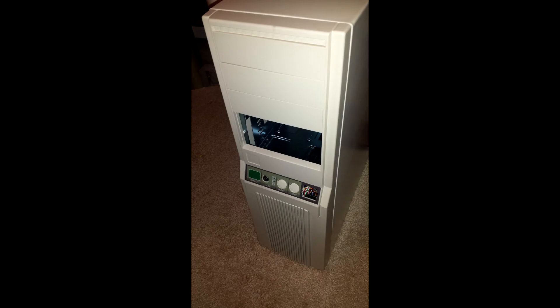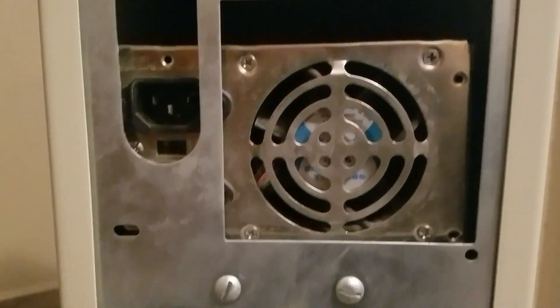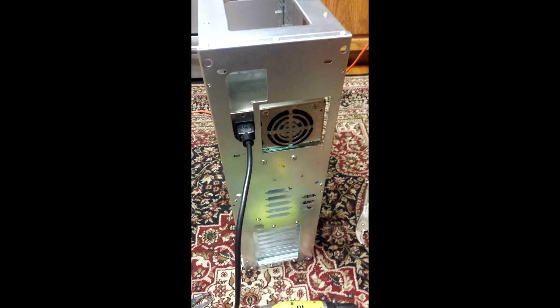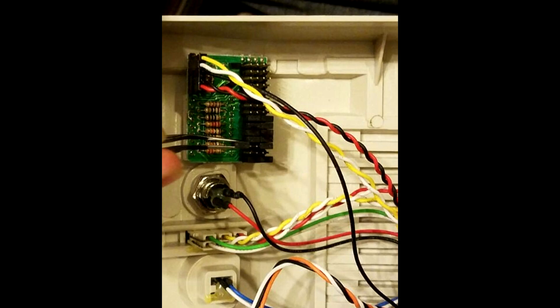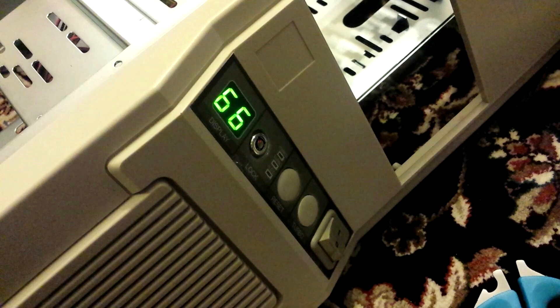Before putting parts together I needed to prepare and modify the case, which was by far the hardest part. This 486 used a different form factor of power supply than the standard AT size. I ended up removing a small bracket from the case and bolting it to the top of the power supply cover, mounting the PSU upside down so the power connector lined up with the opening. The back looks janky but it's worked for three years. Connecting the power supply to the switch was scary since I had no guide, but friends online helped me out. The MHz display programming was also a pain - the diagram didn't match my display so I had to trial and error it.